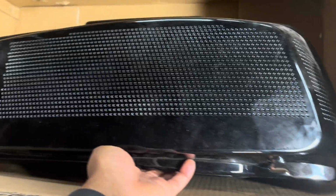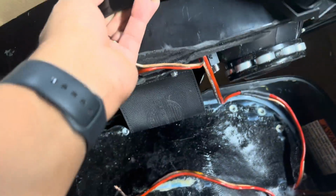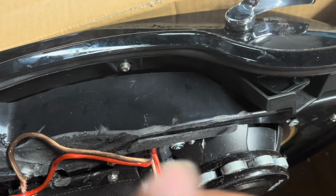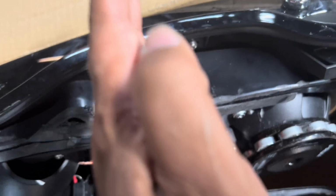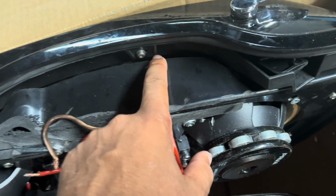Everybody knows I don't like these lids. These are the double 6x9 lids, the Avant Black, I believe. There are a couple of reasons I don't like them. A, water comes in. There's a giant gap along the top. B, it drops down the 6x9, so you have a 6x9 here and a 6x9 here. Then they're fighting for airspace in the top because there's no chamber to divide them, and they're leaking air all the way through. So it's just not a good situation.